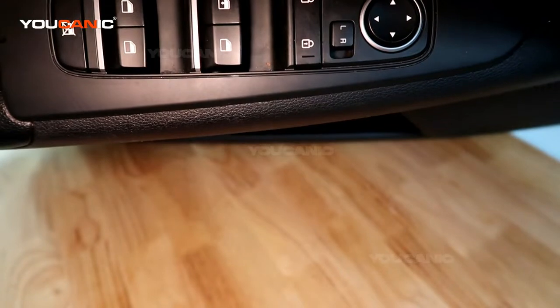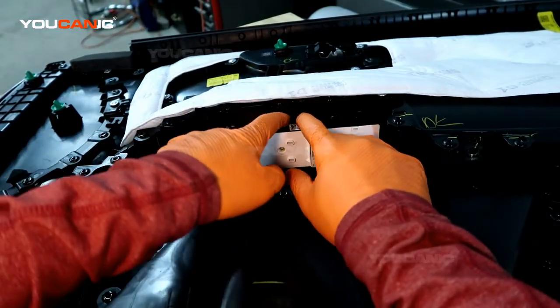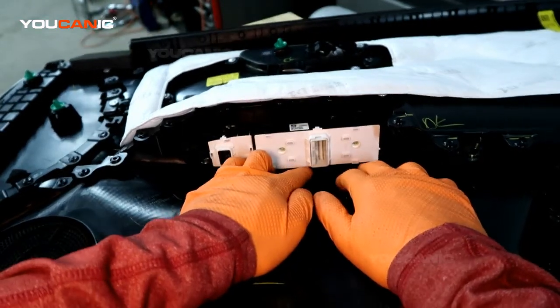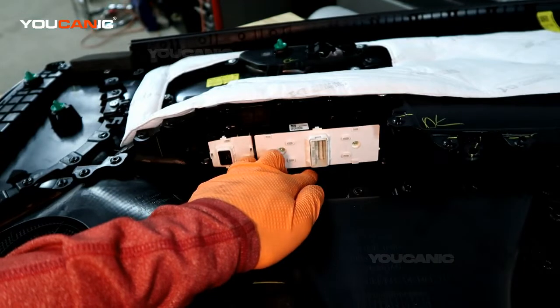With the door panel removed from the car, you can take it, put it on a good flat surface. You've got some clips right here that are holding it in, and some push tabs down on the bottom to be able to unlock and get it to pop out.